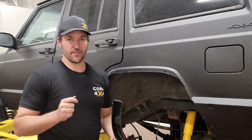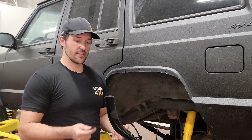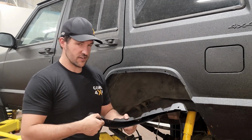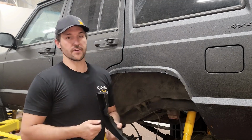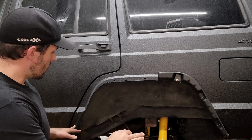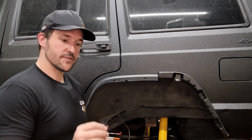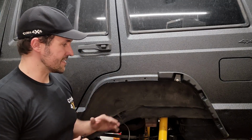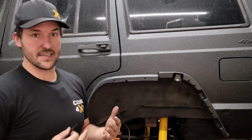And one last thing, before we bolt the fender supports on, you need to install your speed clips or nut tabs here on your fender support so you have something to bolt your fender flares to. All right, so I did get ahead of myself a little bit. On the 2 lower holes on each of your fenders, you're gonna use this little tough lock, is what they call it in the kit, because there's no access to the backside of the hole as it's inside the body.